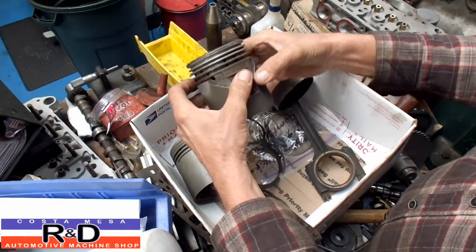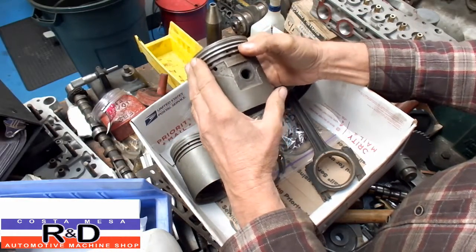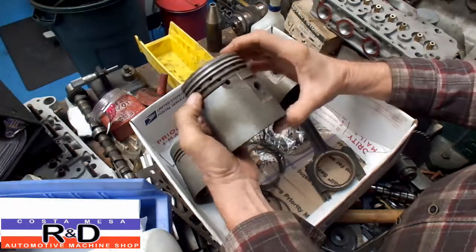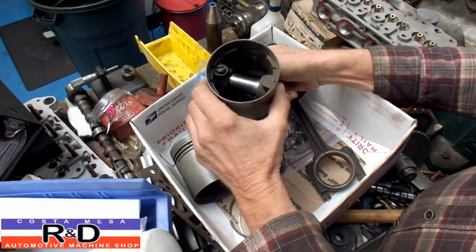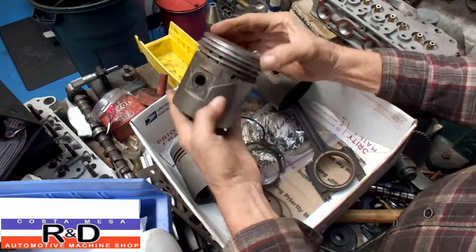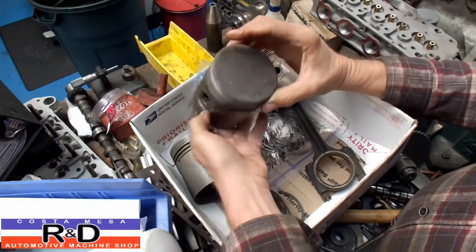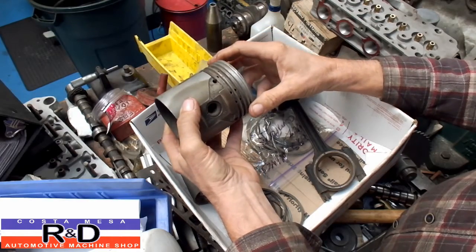By today's standards we just basically toss pistons and put something new in. Plus, these pistons were made out of a lesser alloy than what we have today. With the alloys we're using now, we don't have these wear problems like we did back in the old days. This is just some information that's a history lesson about where we came from with these old-style pistons — hopefully you'll understand what you see when you take some of these older engines apart and find spacers behind rings.